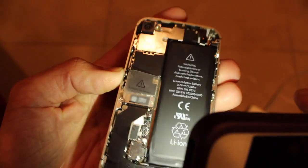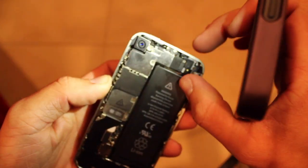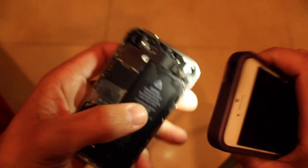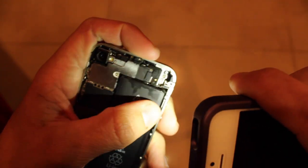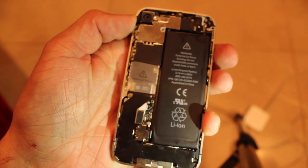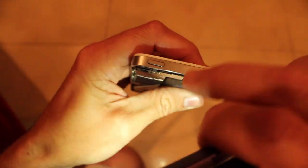This may not be red because this phone was actually put in a bag with Coca-Cola in it. And as you can see there's some moisture right there, but the water must not have reached this sensor, so it doesn't show as red. But the phone is still water damaged because it definitely touched down at the bottom and in the headphone jack.